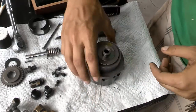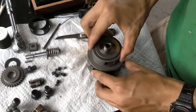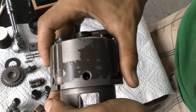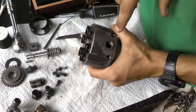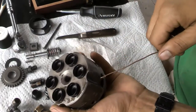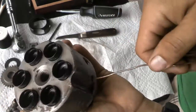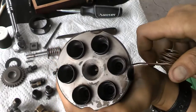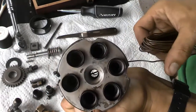When you take that out, you have a little block in here that will do a slip and slide at any angle, so be ready to catch it when you pull this out. On these lines, which you can now clearly see light coming through — on mine, every single one of these except one had debris clogging through it. So what I had to do is take copper wire, or brass — never use metal on metal of the same grade. You're going to scratch indentions into it and cause oxidation, which you don't want. Stick it in that little maintenance hole, and you'll be able to see it go straight through. These holes are actually lined up, so you should be able to take your wire and go all the way through — no problem at all.